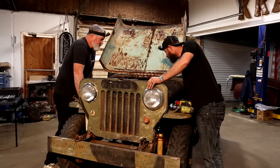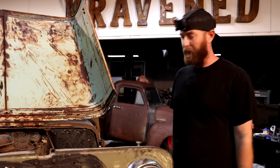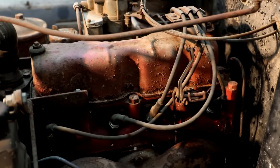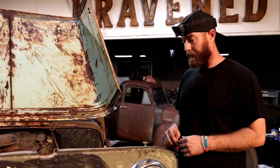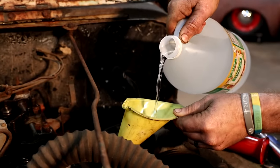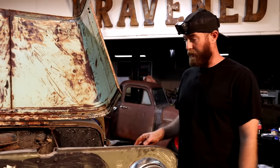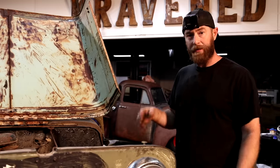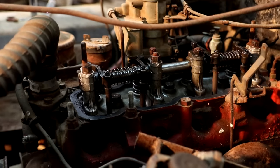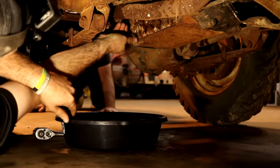Right. Weird. So now that we've dug into this thing a little deeper, we found out that it is indeed locked up, just like the last, feels like 20, we've worked on here. The spark plugs were only put in there finger tight, so that's a little scary. Maybe someone knew this was locked up. They've already messed with putting stuff down into the cylinders and didn't make any kind of headway on it. So we're going to try to put some vinegar or some diesel, some Marvel Mystery Oil. We've tried just about every kind of solution there is, and none of them have worked great for us. So we're going to get something down in there. Hopefully that allows it to break loose so we don't have to pull the engine out to tear into it further. Up underneath the valve cover, it really doesn't look that bad, so that's a good sign. If we can get this to turn over, we can just move on to the next problem from there.